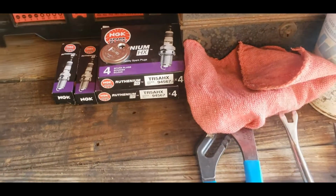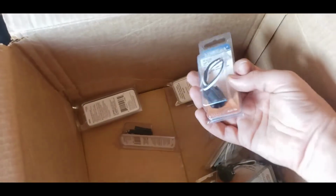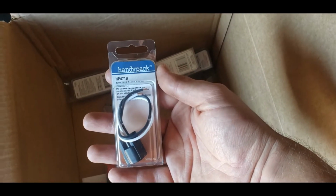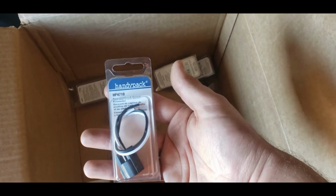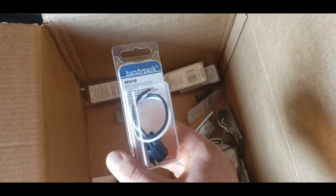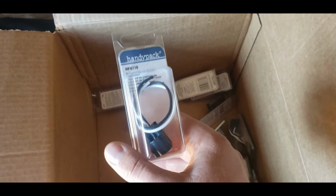I just like to do stuff that way. So another problem that you may have, and I went ahead and ordered all the extra parts that I would need, is that you may have to replace your ignition coil plug-ins. I did all 10 on mine. That's the number. This is also the camshaft and crankshaft position sensor plug-in, so it's used for more than one thing. My strong advice, if you're ordering connectors from wherever, I got these from Rock Auto, is to order a little more than you need.